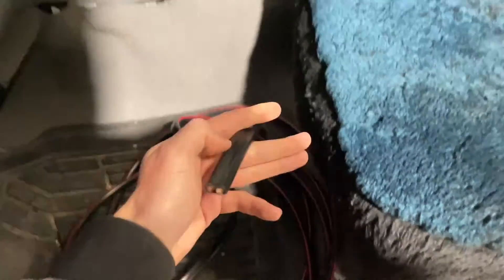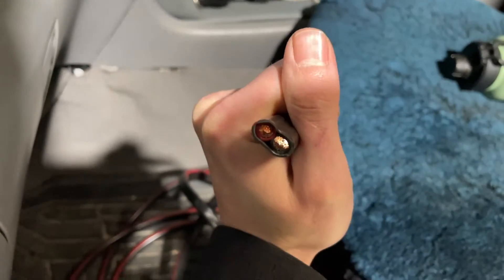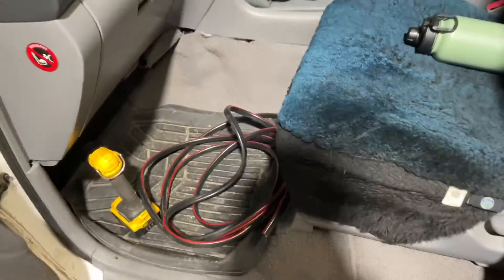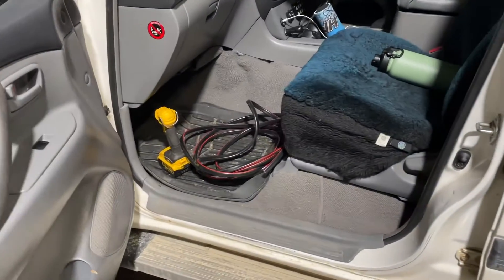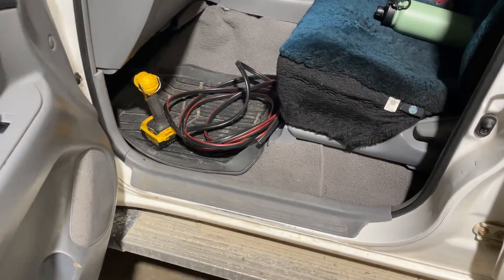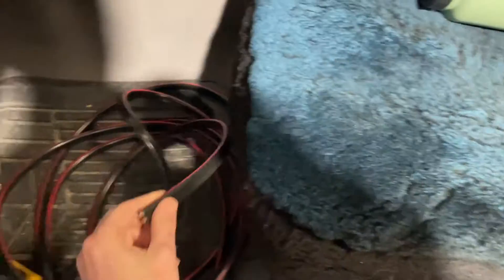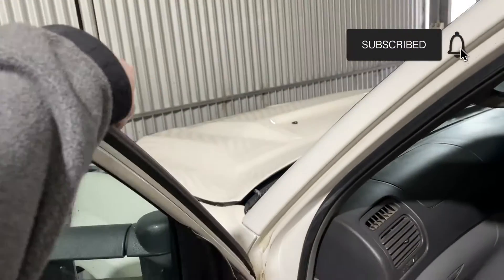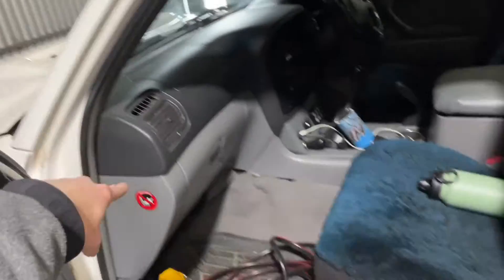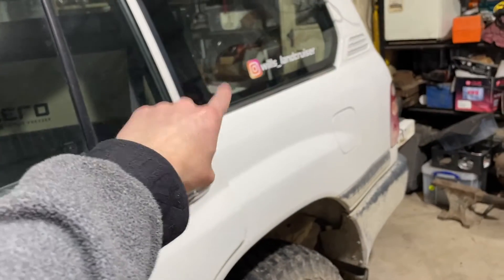The other thing we're going to run is this big heavy wire that's going to go from the alternator to the battery. That's going to be able to handle 50 amps of current — a 50 amp charger into the battery — so we've got about 60 or 70 amp wire. We're going to run that with a circuit breaker from the starter battery, the main battery, through to the lithium battery.